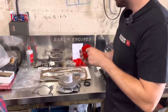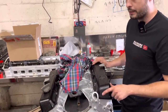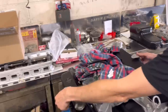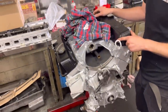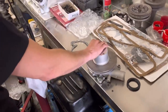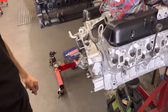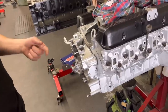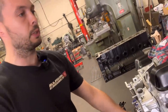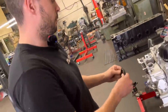Here's Paul. So the V8 — we've got the rocker covers painted Thursday/Friday, so they've all dried up nicely, they look very nice. Just been putting some of the fixings on, putting new bolts in them. The water pump's turned up for this engine now — it's a big old pulley on the front of there. Just getting a few bolts sorted for that, making sure we've got all the right bolts so when we go to bolt it on properly we can do it quickly. So that's really all we've got to do on this apart from the sump — and there's no reason why the sump can't go on. The modified seal — John's found a different type of seal, we've got to knock the housing out and it fits in the front cover. Makes life a lot easier, fits much nicer.